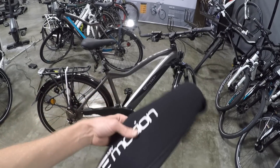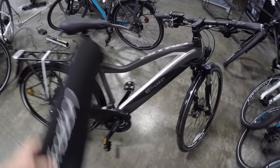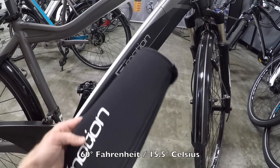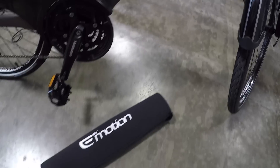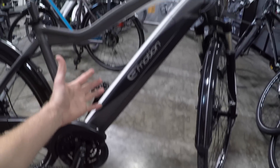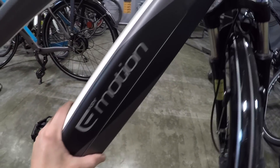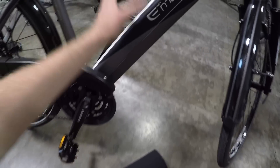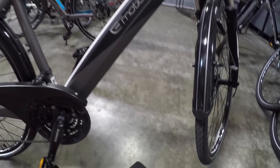Another really cool option they're selling now is this neoprene sleeve — it's almost like a wetsuit material and it's designed to keep the battery a little bit warmer or at least protect it from the cold. They say anytime it's below 60 degrees outside, this is going to help extend your range potentially by up to 30% by keeping the battery a little bit warmer. I feel like there are some caveats there — like the battery must already be warm from being stored inside. If the whole bike was stored cold in your garage, this is just going to insulate the cold. So I would try to keep the battery at a neutral, cool, dry location and then potentially get yourself one of these.